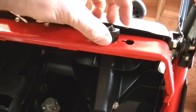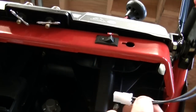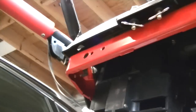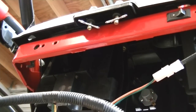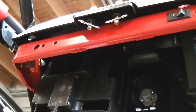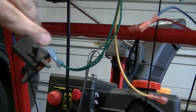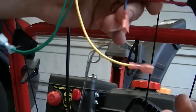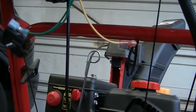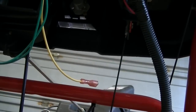So what I'm going to do is take my on/off switch — there's already a hole here — and press that in. I'm going to grab the one connector to the right handlebar grip, connect that, and travel over to this side. There's another connector right here, and this is the left handlebar. Now what I'm looking at is this dangling wire here, this harness. I've got a fuse, I've got a yellow and a green, and I've got a blue and a red. The blue and the red are going to go up here into my heater switch. And so now all that leaves is the yellow and the green, which is going to go up here to the headlight.